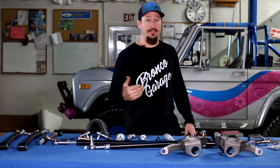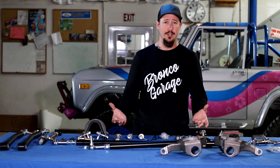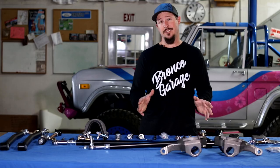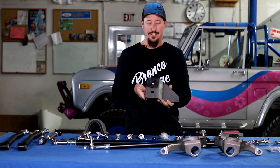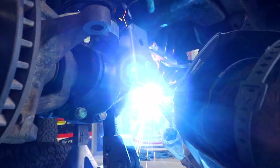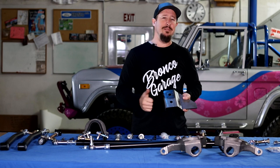Let's hit on some of the accessories to consider for your Bronco and this steering system. You're probably wondering: is this the right system for me, what else do I need, and how do I put it on? I'll cover a ton of that in the install video, but let me show you a few things to consider depending on how you want to set your Bronco up. This riser bracket here is used when you want to put your steering system up and over the knuckle — that means you've got to raise the track bar at the axle at the same time to keep the correct geometry between your drag link and your track bar. This is actually a very important component of the James Duff bump steer eliminator system. So: riser bracket, heim steer, and then you'd want one of their adjustable track bars.